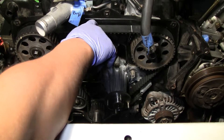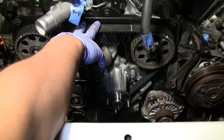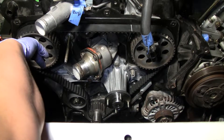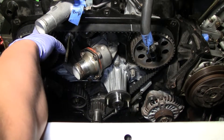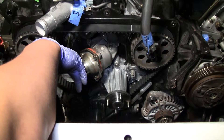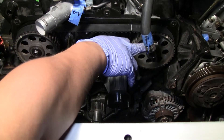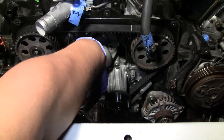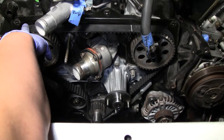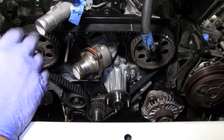I'm going to keep an eye on this. I hope I'm not a tooth off — I'll know right away because the engine will run poorly if it's off. I believe this one and the crankshaft are on correctly, but I'm still a bit curious about the one that looked slightly off. I'll keep an eye on it. Alright, so the timing belt is on.